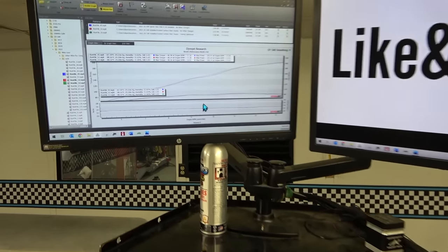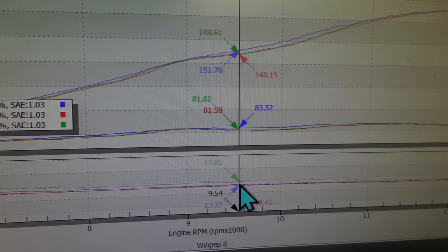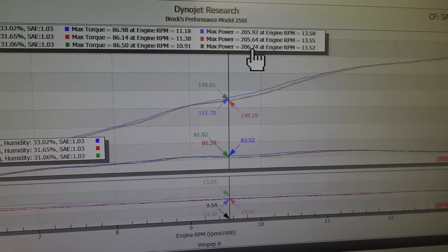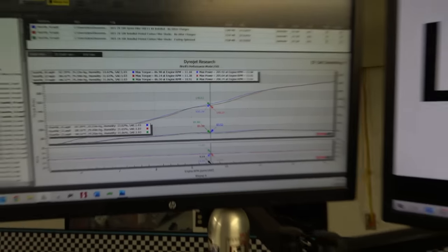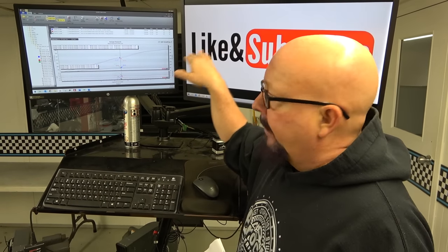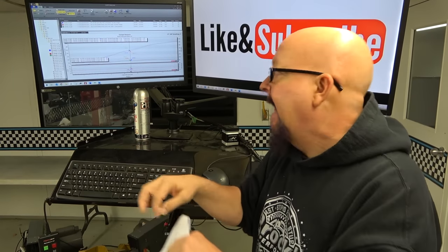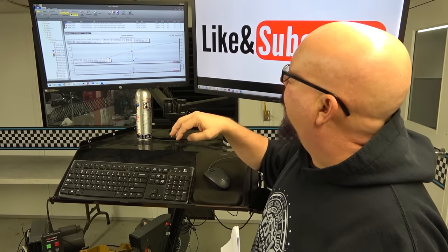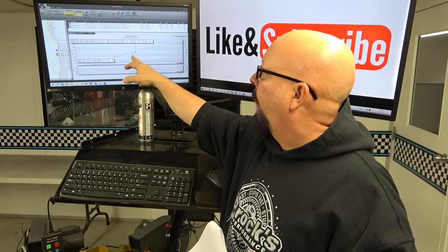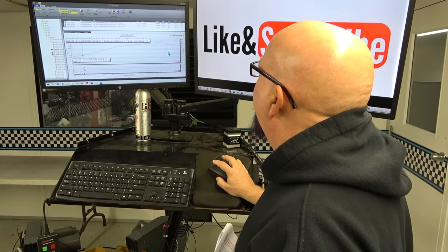You can come in here and look in this area. You can see the air fuel ratio optimized is considerably different, but look at the power reading. It's obviously the best for what's going on. So that's the best comparison I know how to make. That is the carbon fiber stacks tuned to peak performance compared to the other ones tuned to peak performance. And we still have a little bit of lost horsepower down here. Let me see if we can go in here. I'm gonna zoom in a little bit more.